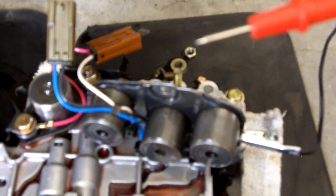Unfortunately, I'm not hearing that on most of these. So let's go ahead and begin with the test. I'm going to switch this ground to the solenoid that I know is working — just move this over here. This is the ground wire coming off the solenoid. Just clip the ground there and apply the voltage to the lead. You can hear it cycle as I touch the lead — that's what a normal solenoid should sound like. All's good there.